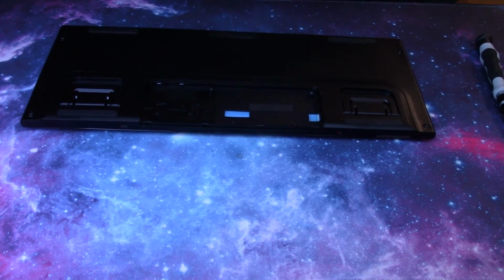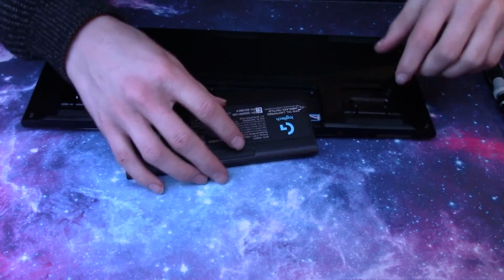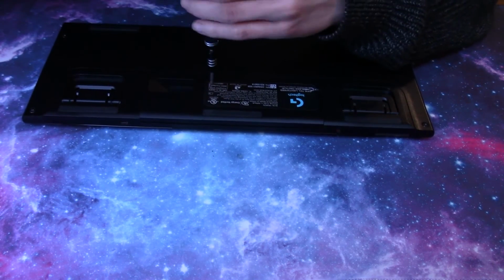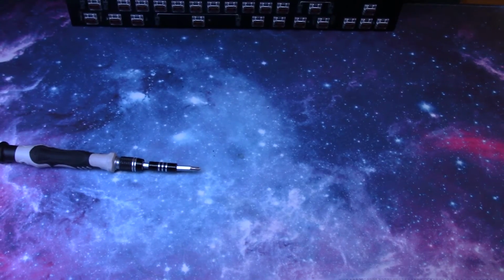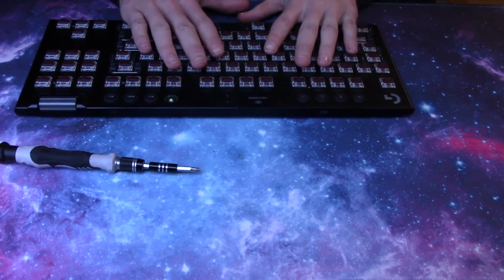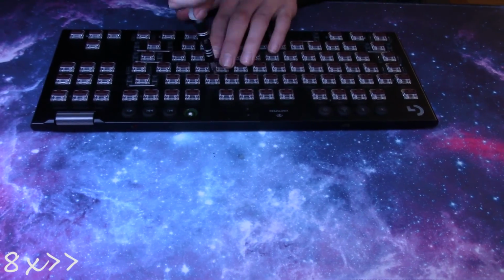And then you can put your battery back in, which you just have to line up, plug it in first, and then plug it in with your nails, and then it just clips back in for the most part. And then tighten the screws and it should fully clip back in. Like that. And now you have to do all of the top screws. These top screws aren't very tight. These are small screws, and I wouldn't tighten them very much because they would strip really easy. You just tighten until they're in there, and then you let go.